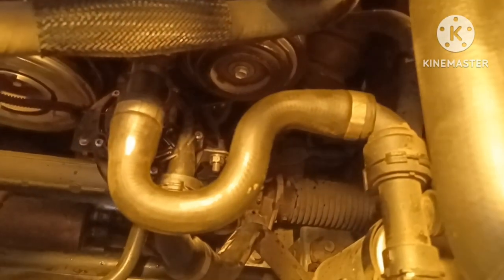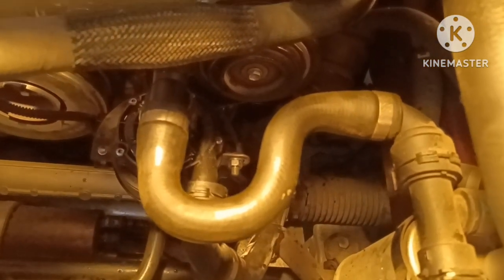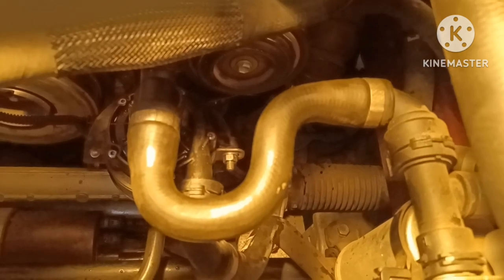There's my little 10 millimeter bolt right there in the center — that latches the hinge bracket around the coolant piece. That wire right there — you just pull it off like that because it's got little shark-bite teeth in it, then click it back on. You've got to get those off to get the belt off or it'll be in the way. The belt is all wrapped in there nice and tight — the belt's good to go.